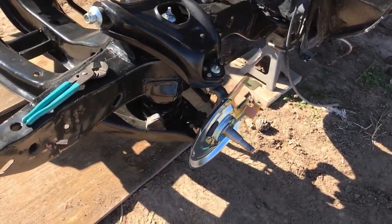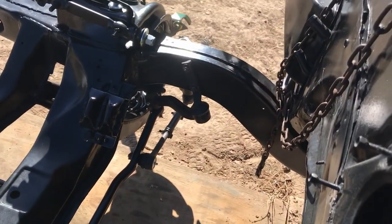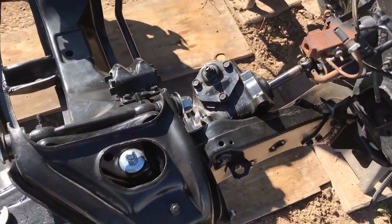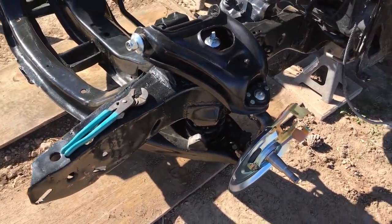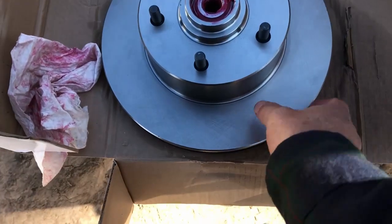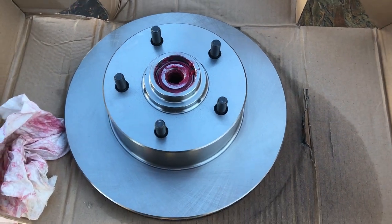We're back. I've got the backing plate and the caliper mount on the spindle. I have the steering box mounted, the cross link, a new idler arm, and brand new tie rods. The next thing I'm going to do is pack the bearings and the rotors, then mount the rotors on — we'll come back at that point. I've got the bearings packed and I'm getting ready to put the rotor on. I just wanted to show you that I've got these done with the rear bearing and seal, so this is ready to be put on the car.